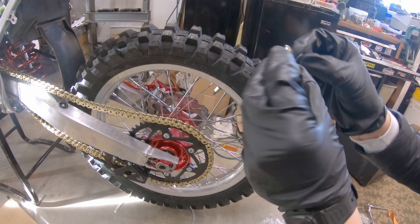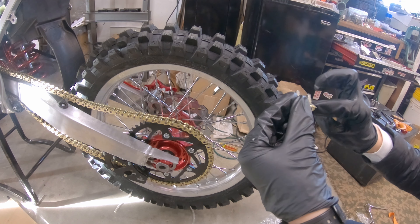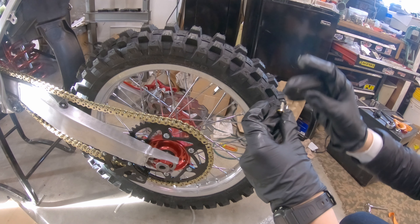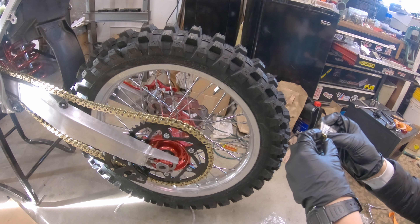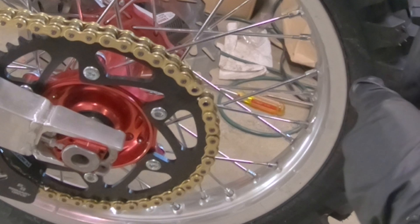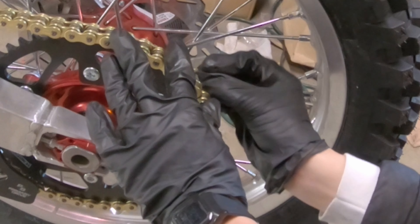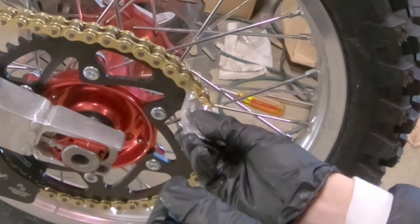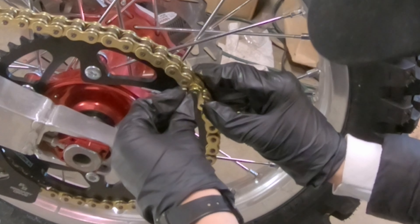It's good. I just had to compress the swing arm and the shock to get it under the chain roller up front, but got it. So I'm going to grease up the master link here — got some grease they provide. These chains will collect a bunch of dust the first ride, but they last really long because of the grease that's packed inside of them.